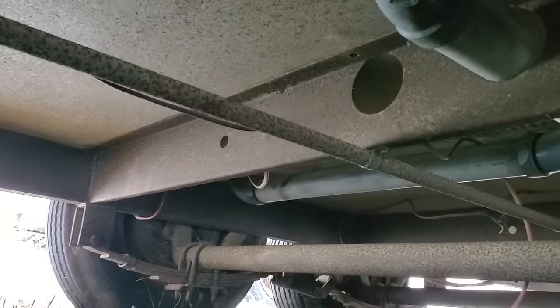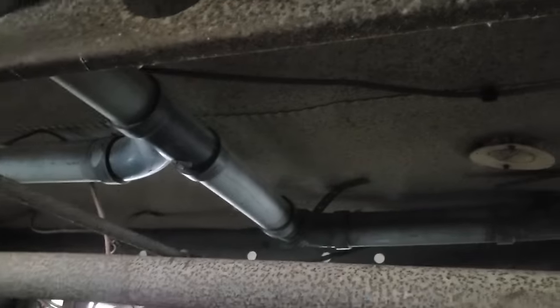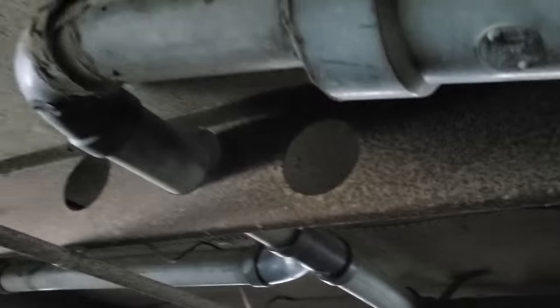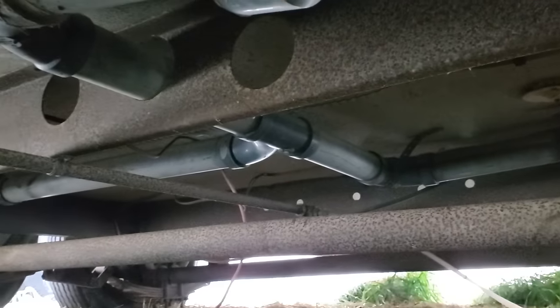So that is the kitchen over there on the opposite side. Comes over here into a street Y. You see the pipe back there. That goes to that stack. That goes all the way up, that is still existing in there. And then this comes this way out to this dump out. And right above me here, this is the white tank above where I said that the toilet would be perched upon. So I don't see anything else. Let me crawl back there in the back. But I don't see any other tank other than this white one that was inside. Oh, it's so wet and cold.